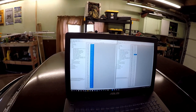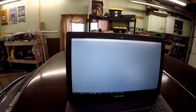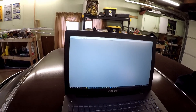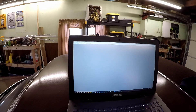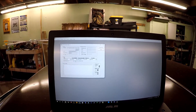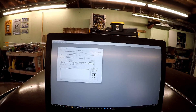The software I'm using to actually write this to the PCM is called Digital Horsepower. It is outdated as hell, but it works great for what it is — and it's unlocked too, so you don't need to use credits, which is amazing. The UI is kind of finicky, but it works well enough. One of the things I'll need to do here is clear the fuel trims, and then I can just do a partial write — this will just take a few minutes.